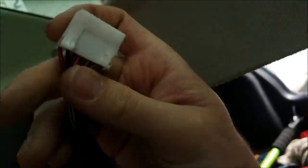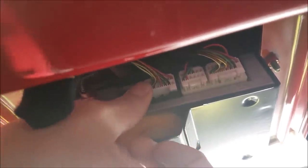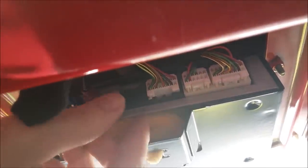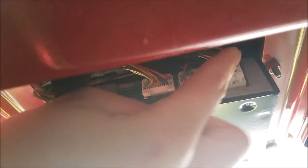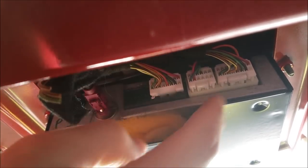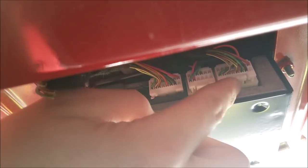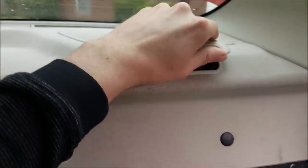When I ground it down I went a bit excessive and lost the tab — just know when you do this, don't go as grind-happy as I did. Without that tab it can eventually work its way loose, but it's still pretty tight. I used one from the wrecked car; this is the only connector you need to modify at the junkyard.